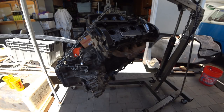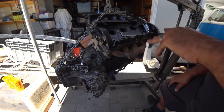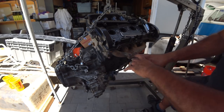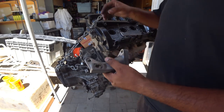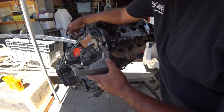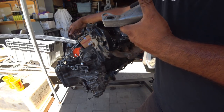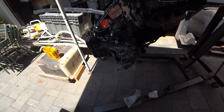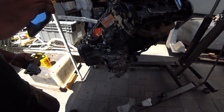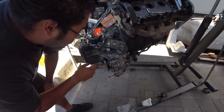One thing you're going to need to focus on are your parts. There are four brackets technically to mount this engine and get it in correctly — three that go on the engine and one that you have to put on the cross member. Bracket number one will be your transmission mount. This comes off of a G60 Corrado. The part number will be 357199353A.